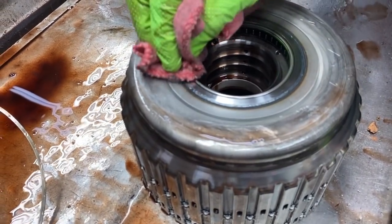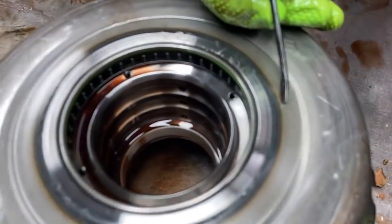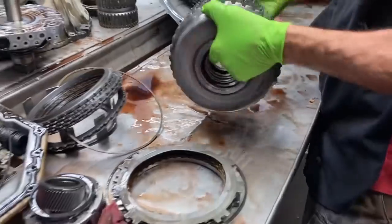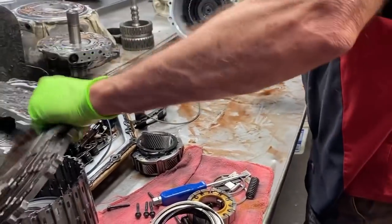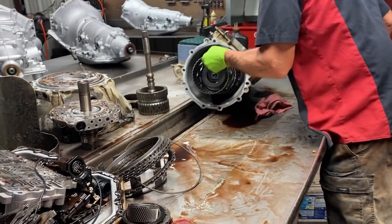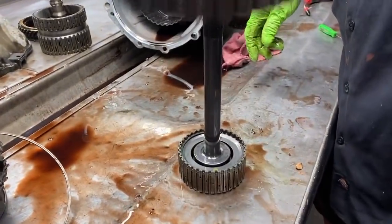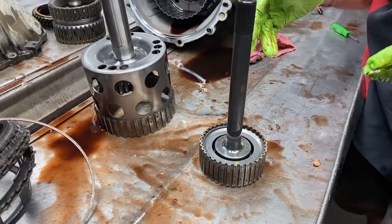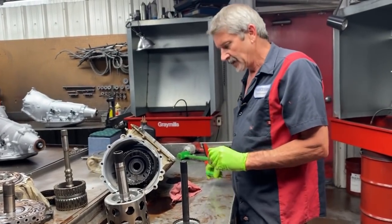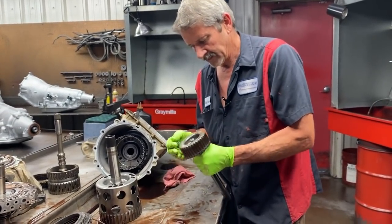Where is it at? There it is right there — see that little tiny hole? So when you air check it, you will have air come out of that hole, and that's not a crack or anything like that. Keep your snap rings together. Now these drums here — when you go to put the bushings in and stuff like that, your standard bushing drivers won't work. We physically had to buy a special bushing driver kit just for this unit, because it's so easy to damage the bushings when you're putting them in.